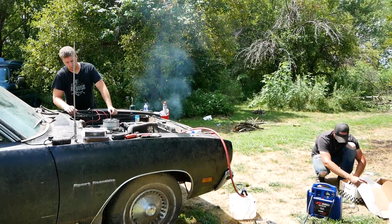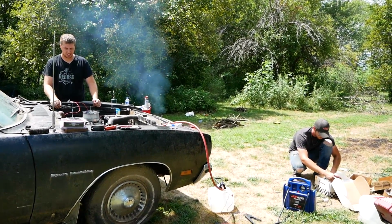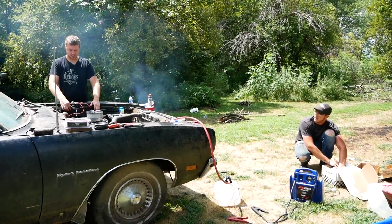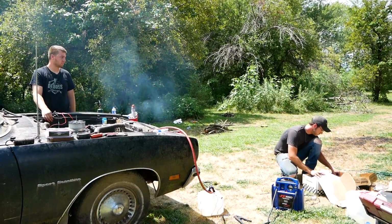Hey Luke. Yeah. I got an 1/8 inch thread on the back of this, and these plugs for that vacuum leak. What do we have for 1/8 inch thread? Do we have anything? Well, if it was just 1/8 inch, but is it an 1/8 inch MPT? Yeah, it's an NPT. I don't want to sacrifice your carb and fill it with silicone or something.